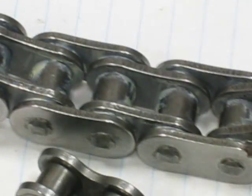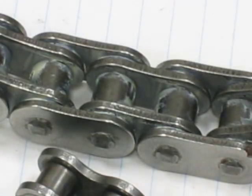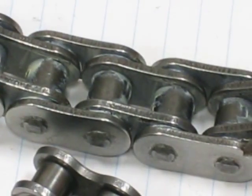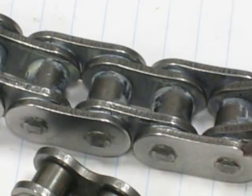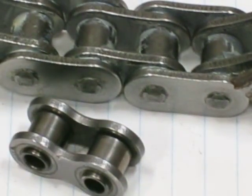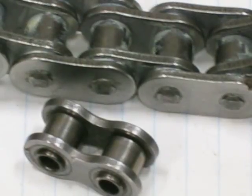Those are the surfaces you need to be concerned with. Make sure you get top-quality chain cleaner and top-quality chain lubricant. Manufacturers recommend you do chain maintenance every 1,000 kilometers — more often if you ride in the rain. Here in beautiful British Columbia it rains maybe 10 months a year, so it has to be done almost incessantly. Alright, have fun riding!